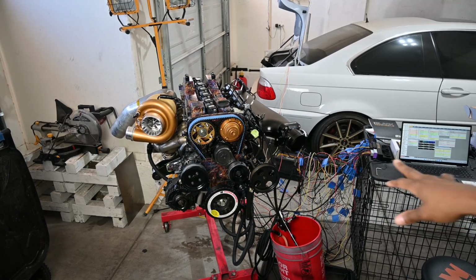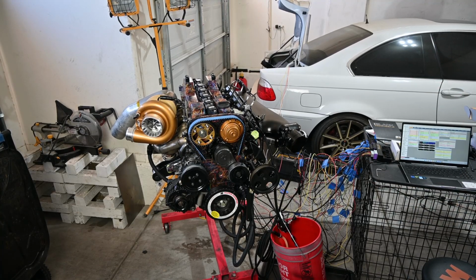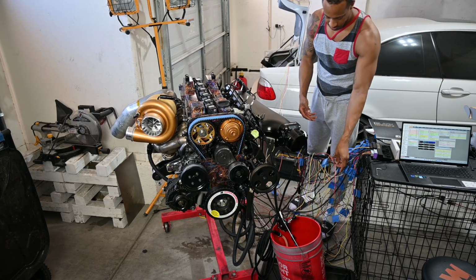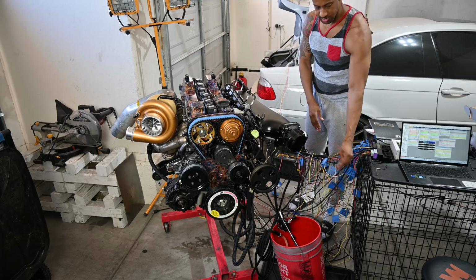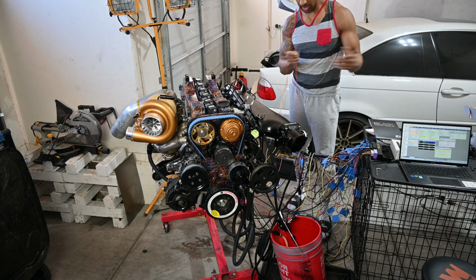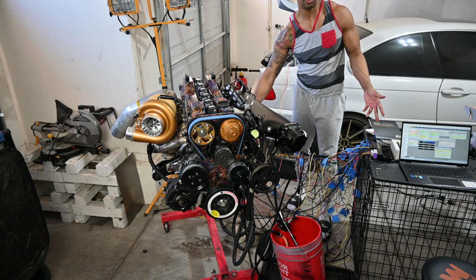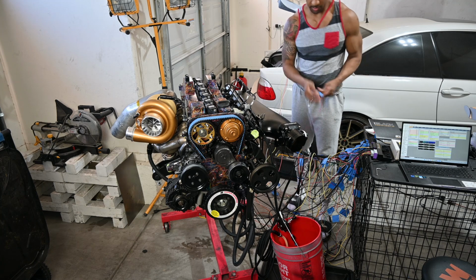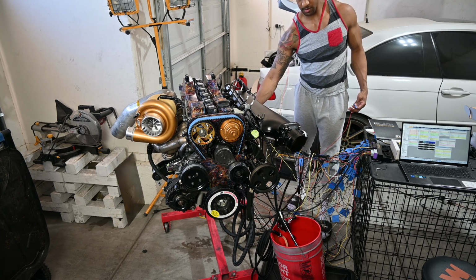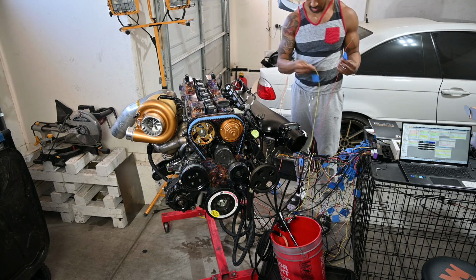All right, so I've connected the negative to the battery. So now everything is grounded. Again, this is the ECU power. So you'll hear it beep once I give this power. All right, that's the ECU turned on, that beep. Fuel pump, same thing, give it positive connection. Fuel pump starts running. Simple.